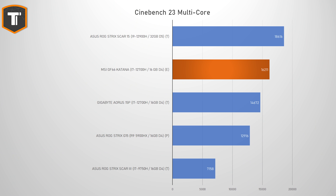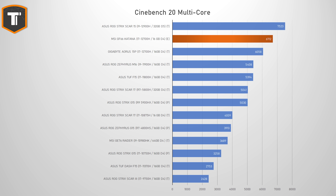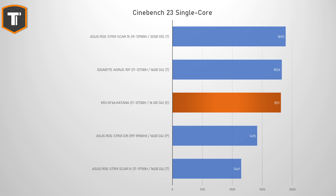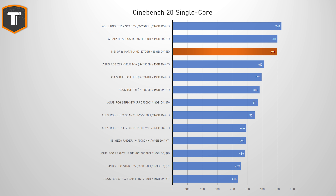When we look at CPU performance, this laptop comes with an i7-12700H that has six P-cores and eight E-cores with a total of 20 threads — the same as the i9-12900H. Just like other high-end Alder Lake laptops, this one performs very well. In the extreme profile it runs at around 80 watts and shows really good multi-threaded performance, beating 11th gen Intel chips and any 5000 series AMD laptop, and it's not too far from the 12900H in the ROG SCAR running at 115 watts. Single-core performance looks very good too, which should definitely help in games.